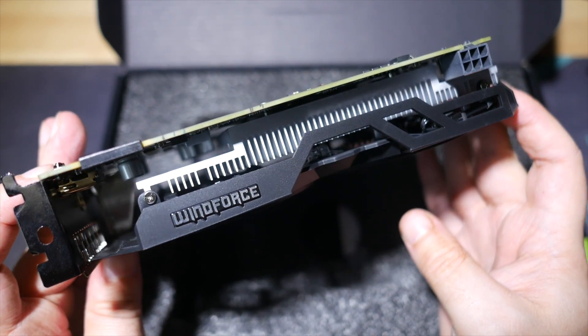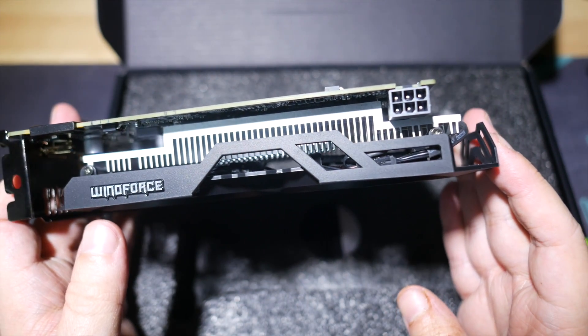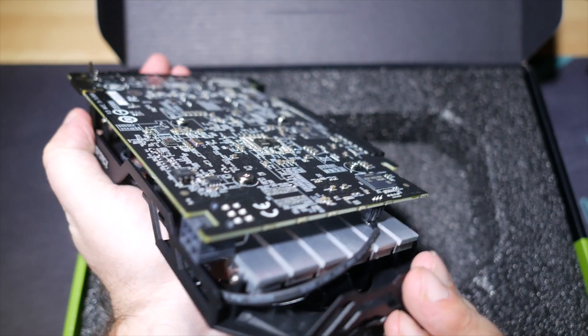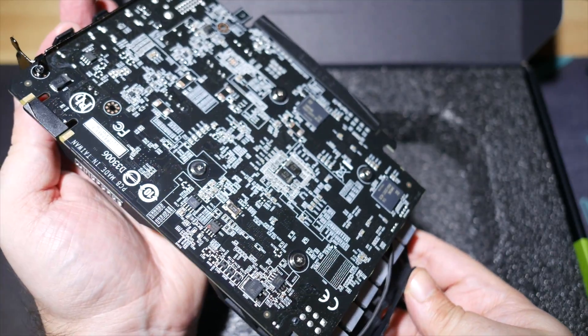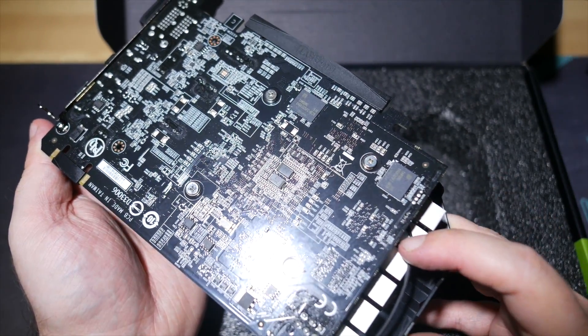In practical terms, that means so long as your system has a PSU capable of about 450W or more system-wide, the GTX 950 should be quite happy inside your rig. Like all GTX 950s, it's loaded up with 2GB of GDDR5 memory running at 6.6GHz.